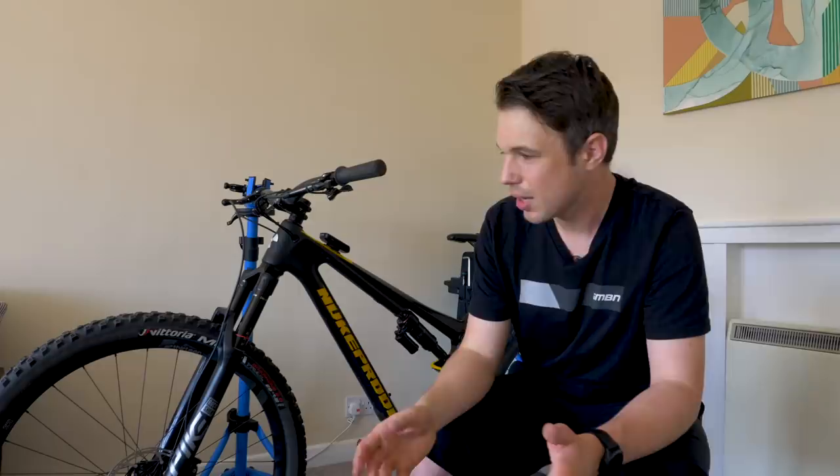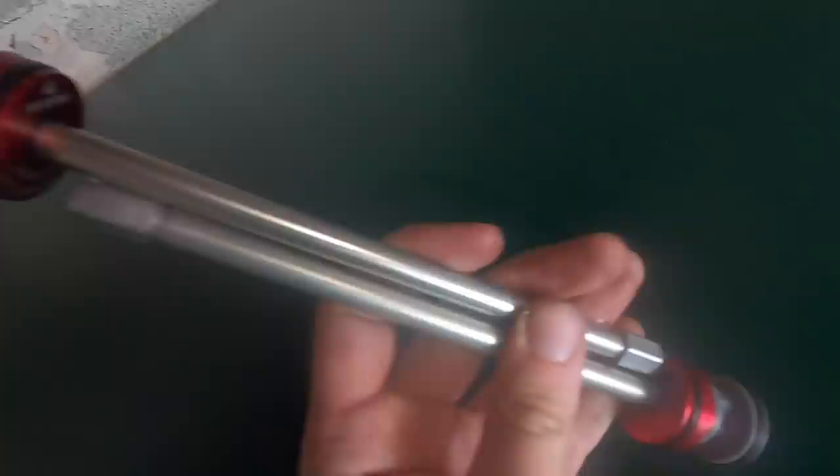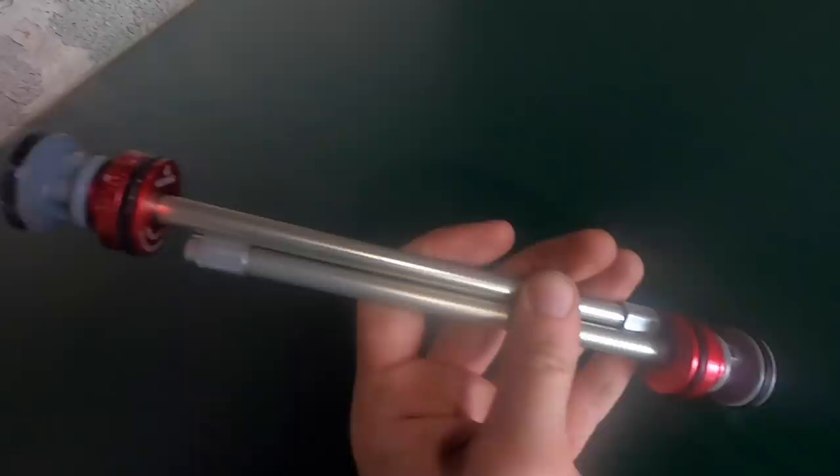I'm trying to do all these changes for £100, but you could also put on some lighter tires. This isn't something I would do week in week out, but if I had one bike like this and I wanted to go for a 100 kilometer cross-country epic, would I do this change? Absolutely — especially the fork, that's a really big one. You could just pump up the shock a little bit harder, but for the fork there's no substitute for that.